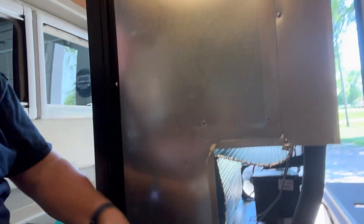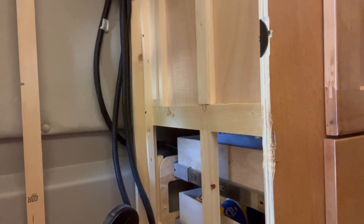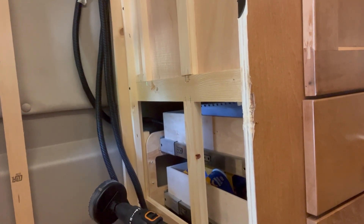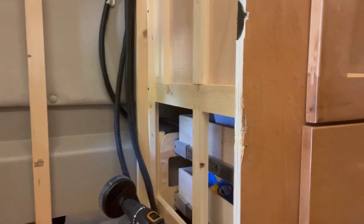When I took the fridge out, it had this white insulation all around this area here, and it occurs to me that that's not helping anything either because the fan is blowing. There's a lot of air coming this way right now, but if we take a look at the cabinet that it's in, my new hole should allow a little bit of cooler ventilated air to come in, but there's really not a lot of place for it to go - it can release into where those drawers are. We've got our mac and cheese in there for our fine dining while we're camping! What I'm going to do is cut a hole in this side of the insulation as well, just so there's a better chance for the air to circulate and flow a little smoother, because I think that's probably been part of my problem.